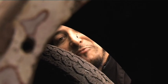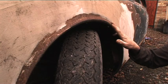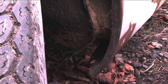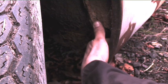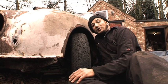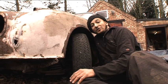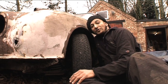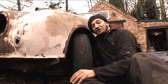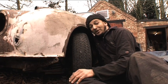The main places we're looking at here are the main wheel arch itself — this one has already received a new fill. We also need to look at the crow's feet, which are below the headlight and tucked underneath. Those are always rotten, and some of the sections below there will also be very rusty indeed. Most panels are available new for this car, so we're well sourced for parts, but of course they do cost money. Be careful what you buy — replacing a whole wing will cost more than a thousand pounds new.